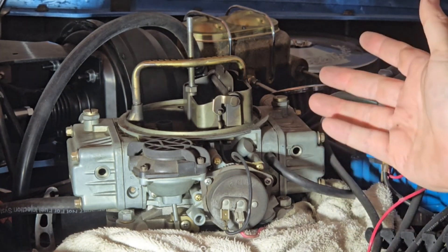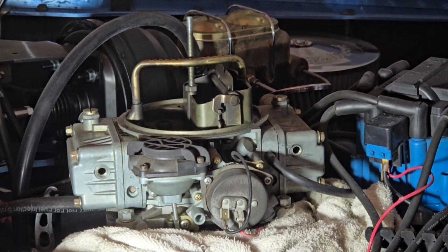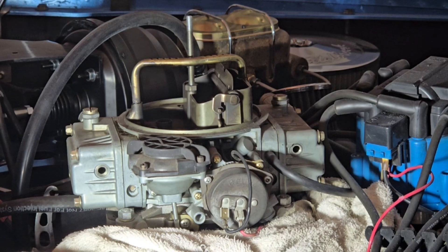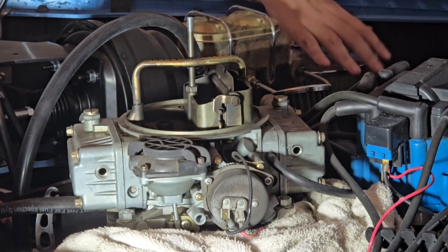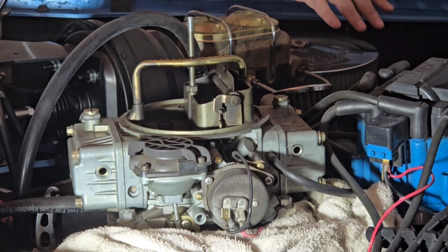So I'm going to go ahead and start it. Make sure you put your vehicle in neutral, and also make sure nothing's in front or behind, and you chock your wheels — all that good stuff for safety. You really don't want to run it too long. I do have a towel there to help catch any kind of fuel, but you don't want the engine to heat up too much, which could potentially cause the towel to catch on fire. So make sure everything's secure before you start.